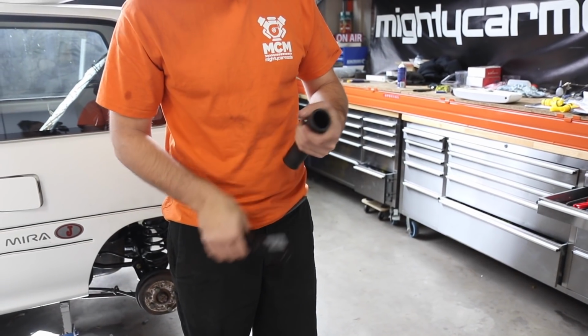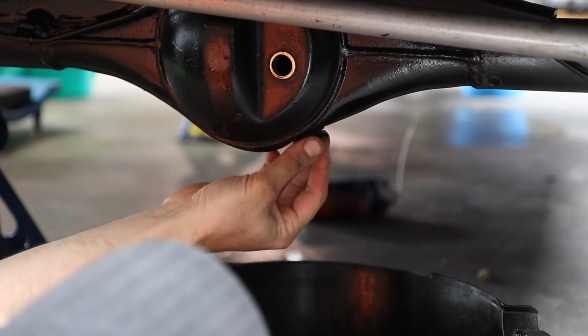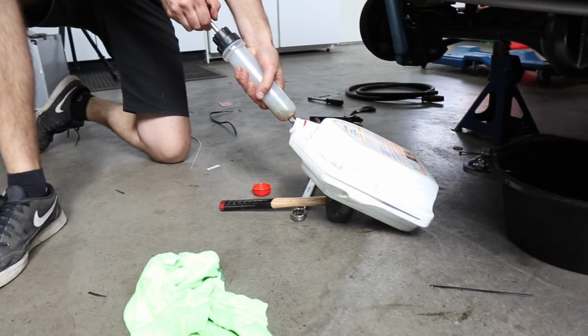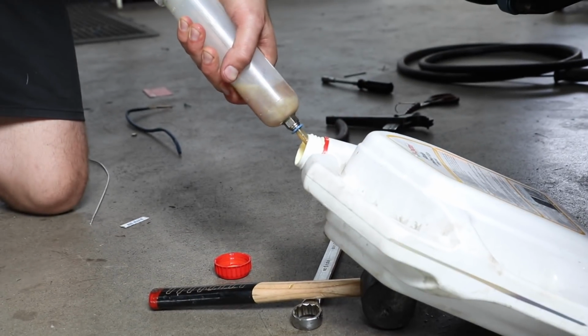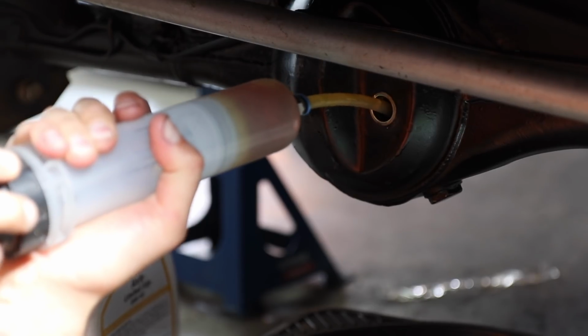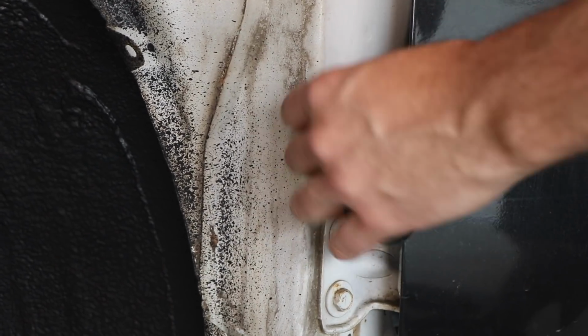It's important to use hose that is suitable for the kind of liquid that you're going to put through it. Radiator hoses, although the same size as this one, won't last with petrol sloshing around inside them. I'm going to change out the fluids so I can keep track of their lifespan, as I've got zero service history from the JDM car. Next, I can plug in the door looms, which means power windows on both sides.